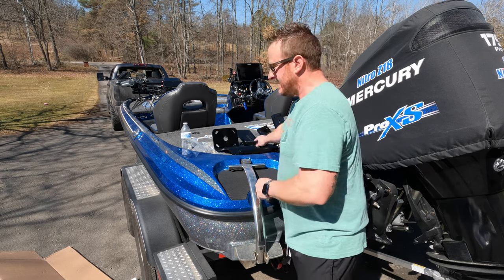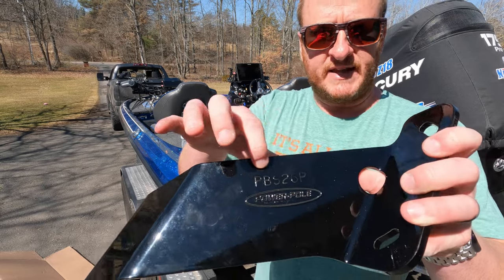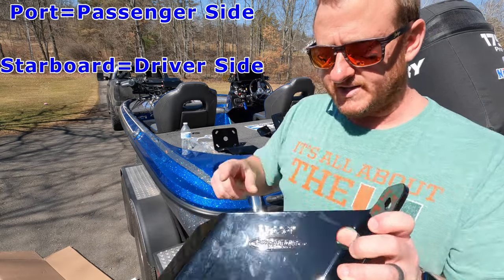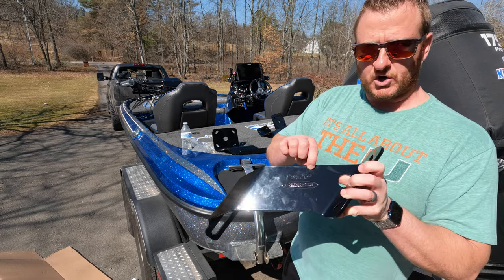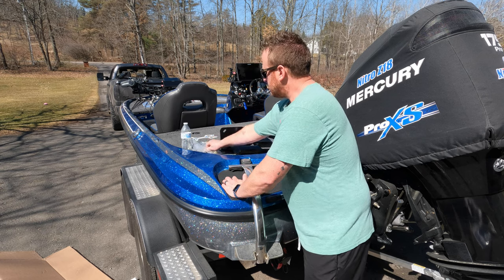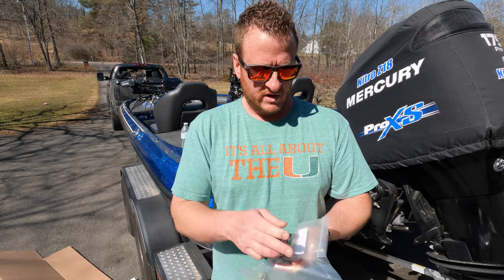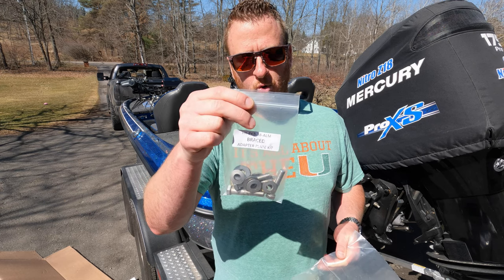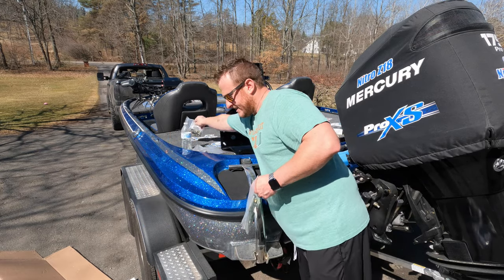The starboard side bracket is over there. To know which one is starboard or port, it's engraved in the brace — the last letter P is for the port side. The same thing is engraved on the bracket itself and the brace; the other set has the S at the end for starboard. So if you're not sure what side goes to what, just check that last letter. You also get four bags of hardware — two that look like this for the bracket-to-jack-plate connection, and two more if you get the braced option. We're going to set the smaller bags aside for now.